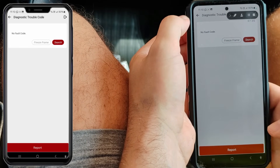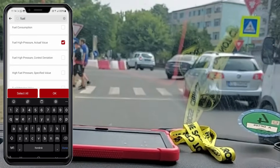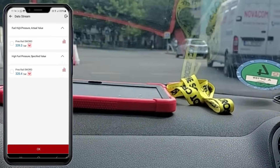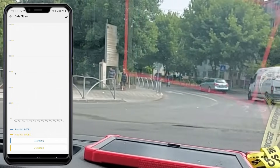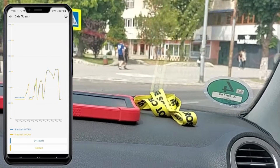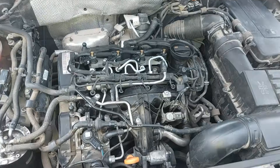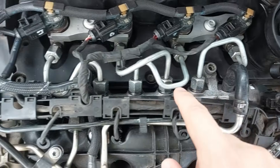I'm sure these codes will come back so we'll need to do a few more checks. I'm pretty sure we'll also see a problem in the data stream so I'll test that function as well. I couldn't capture the moment on camera but there are times when the actual rail pressure exceeds the specified value by even 80 to 90 bars — well over the plus or minus 20 bar limit — so most likely we have an issue with one of the high pressure regulators. Unfortunately in this case there are many suspects when dealing with this kind of error so we'll start with the least expensive exclusion.